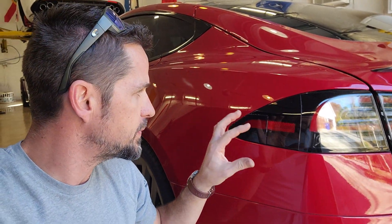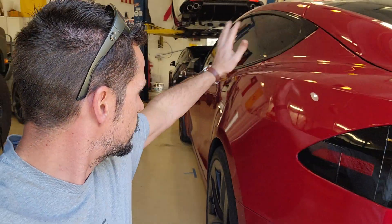This video will have more than that because we will show the coding for it and how we did the door, because that is the hard part. The reason the charging door is so hard is because the metal behind it is different. The quarter panel is all one piece — not that piece, thank goodness. But behind there, there is one metal piece that the charging receptacle is bolted into, and that is different between 22.5-and-up versus 22.5-and-lower models. Swapping out that charging plug requires sheet metal work and is borderline impossible. Most people give up. The Alpharex is a good option, but the problem is they are 12-volt lights and this is a 16-volt car, so they require really massive resistors.